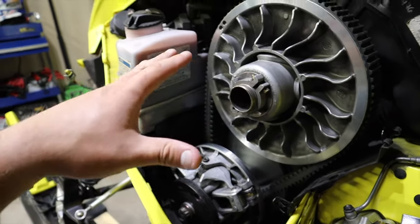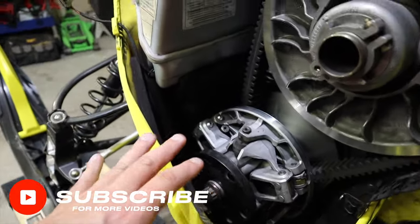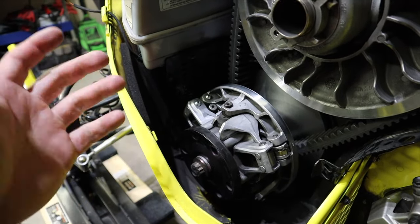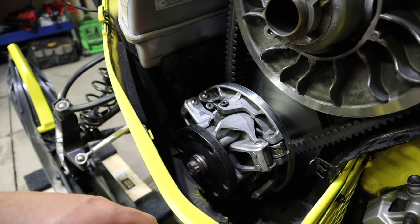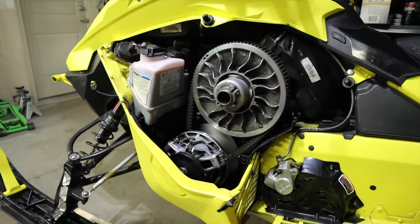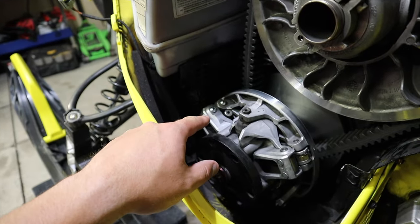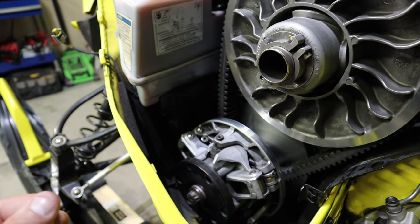Anyway, this is all set up, it's ready to go. I will do another video probably later on about how to take apart this P-Drive clutch — it's really simple and you really don't need special tools for it, even though a lot of videos and people say you do. So there is a way to do it without the special tools. There you go — normal clutch maintenance stuff you guys can do at home that you should be doing. Oh, by the way, torque on the bolts for the roller bearings was four inch-pounds — very, very, very light.